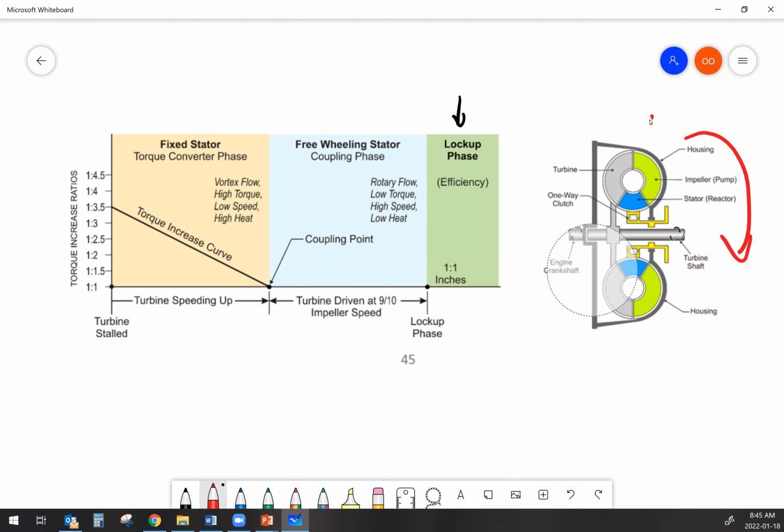So in terms of torque converters in the ag industry, do we have these? Do we use these? Well, obviously not quite as common in the ag industry as it would be in the heavy industry, but you're still going to see them when you have, say, automatic transmissions in your floater trucks, things like that, right? Very relevant in terms of automatic transmissions in all of the automotive stuff that you'd see. And in the truck transport side, we're starting to move away from standard transmissions more in favor of automatic transmissions.